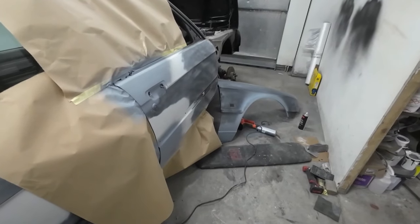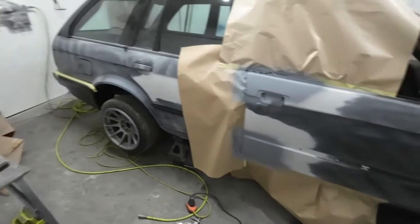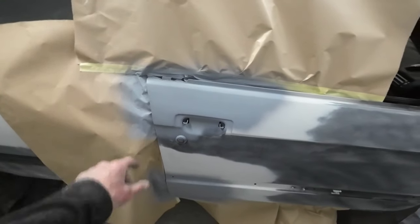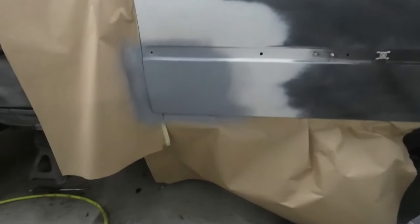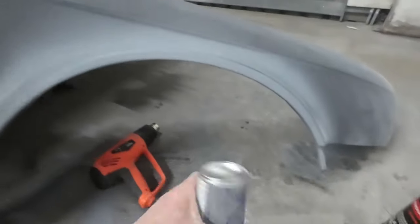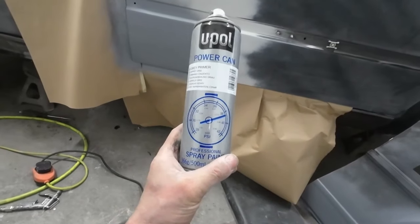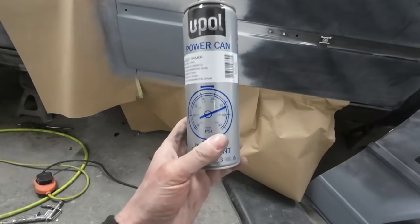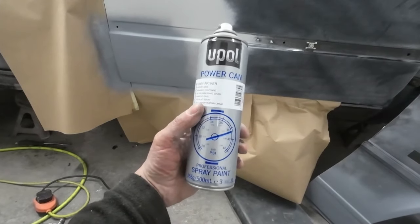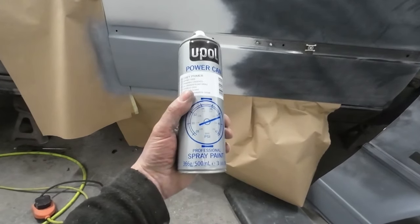Well, I've been bashing on, haven't I? So I've got this door, started prepping this side, and I've got this door, I've primed it again on here, so it's gone through a bit in some areas, so I've just reprimed there in the bottom. There was a bit of a repair to do on the bottom there. I've just used an aerosol primer. So this is a U-POL high build, and if you watch my channel, I'm sure you've seen me show you this before that I've used on other jobs. So this is a decent aerosol primer, to be honest. It's the U-POL Power Cans. It's quite thick as far as aerosol primer is concerned.